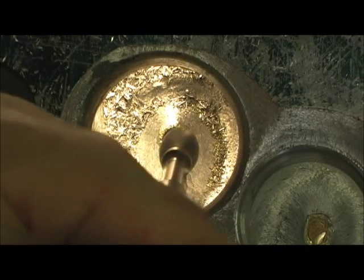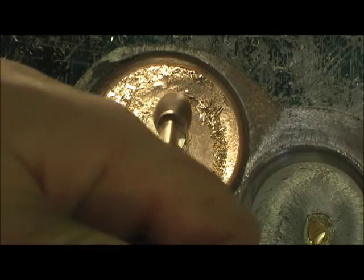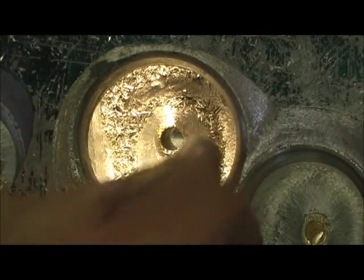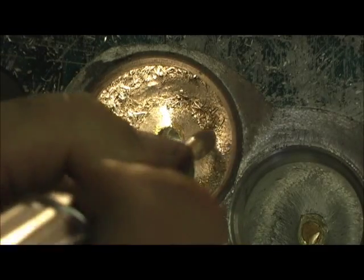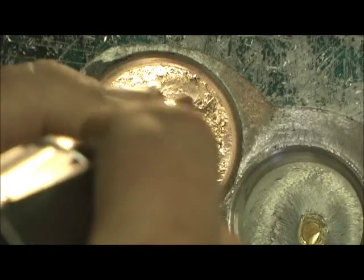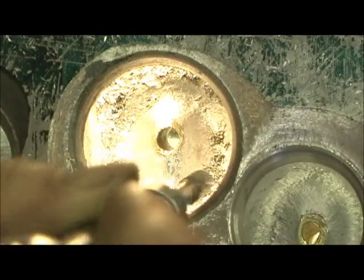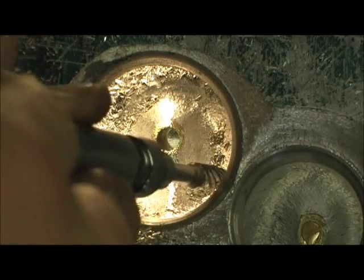Now we're topping. That pulled it in good. I will go in there and just touch it a little bit with a straight aluminum burr and blend these edges. I'll switch to my long burr, and I basically use this to take the rough cuts from where the big and round cutters left off and blend it in. Because I do not polish the intake ports — this is the burr I use to finalize the blending on the aluminum.